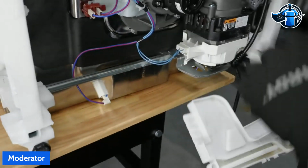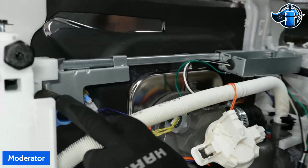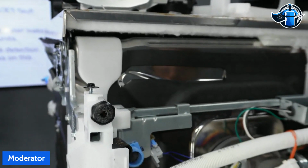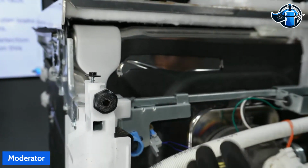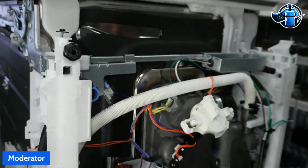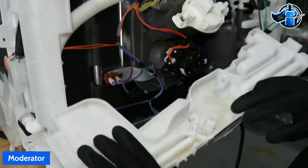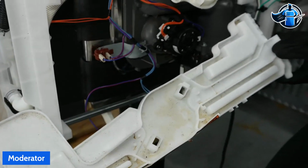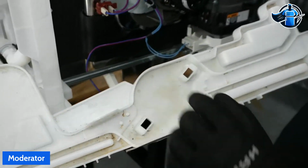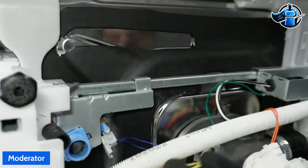Then we have our second potential leak, these little tubes here. So these tubes are attached to these funnels. There's these two funnels on each corner of the unit. And that's why a lot of technicians think, well, if it's leaning a certain way, water's going to hit those funnels and come down. It's really rare to see that. If you're getting water down these funnels and into these tubes, it is going to hit your tray. It's going to be directed into these channels. You can see the channels here. So you have a channel here, comes down. You have your secondary channel, comes down, going into the reservoir. And that's from these little tubes here and from our funnels.